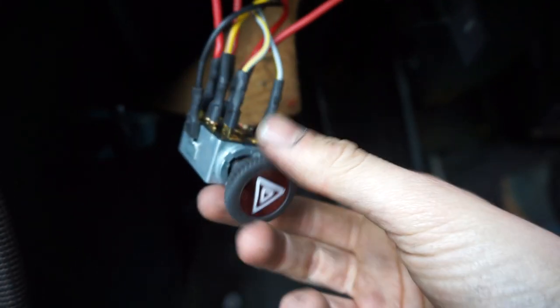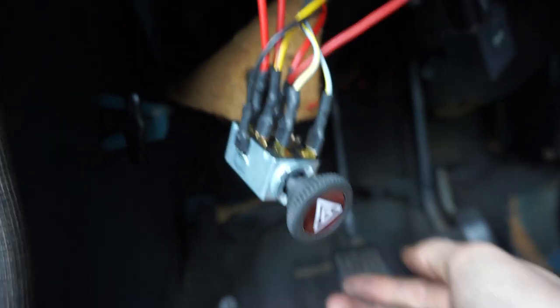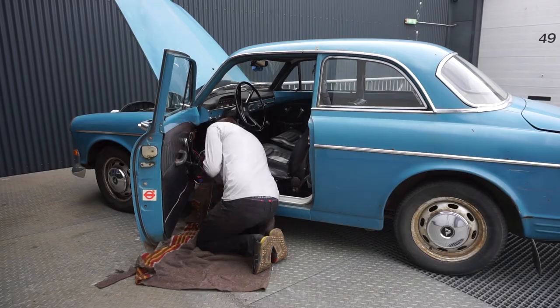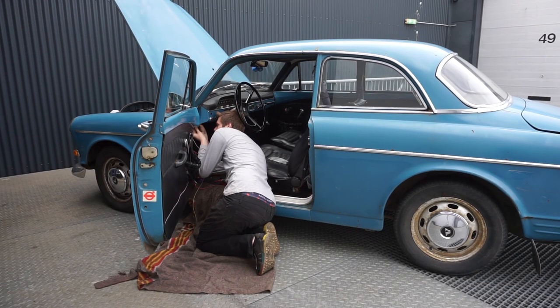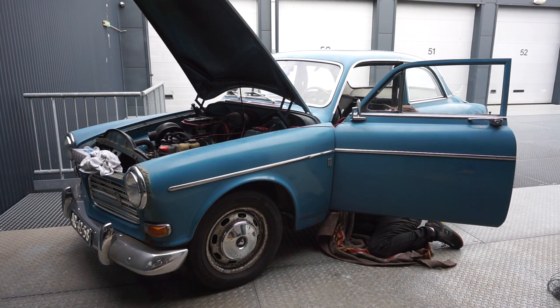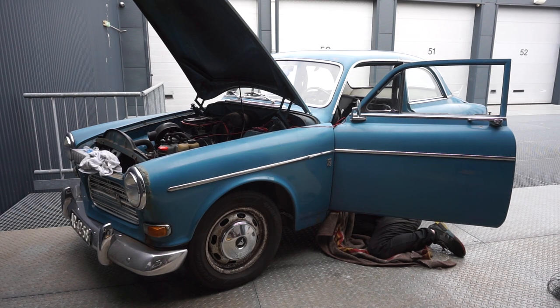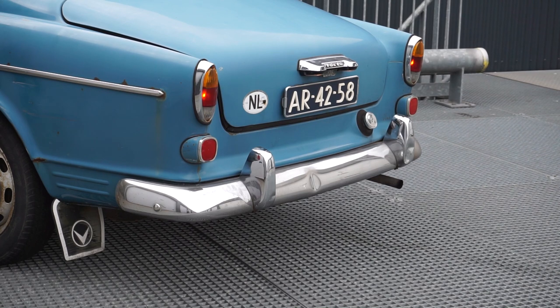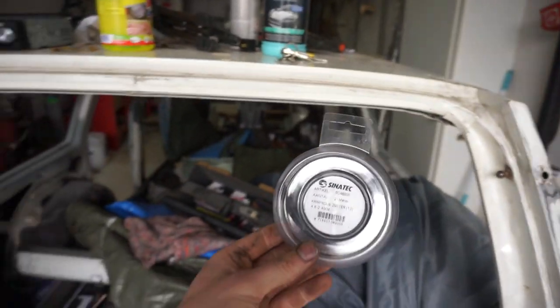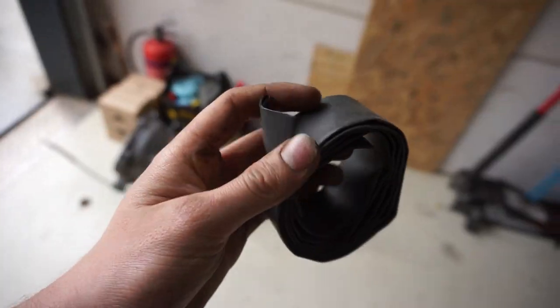I think it's a very easy job. I do have some experience wiring cars, but if you like cars and are doing electrical work for the first time, this is one of the first things you should understand — learning the number codes, color codes, and how to wire things up. Practice your soldering skills and make everything neat. What I highly recommend is using shrink wrap on every connector you make.